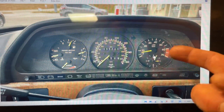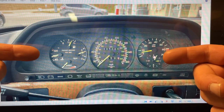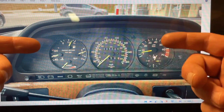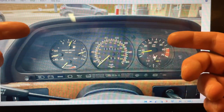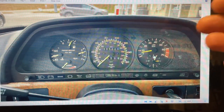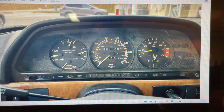This is what you're seeing here: I now have exactly the same idle speed whether the car is hot or at operating temperature or cold, and it starts right away. All the modifications I've made have led me to the correct setting. If your engine is in a similar condition to mine, you should be right there too. The setting that yielded this result is 55 mil.